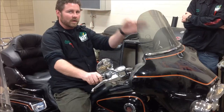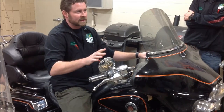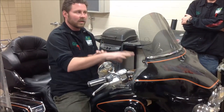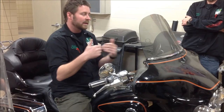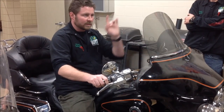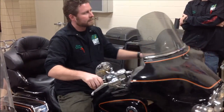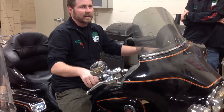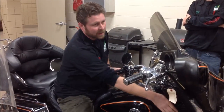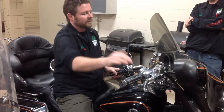So let's do a little checklist review. Before you pull the bike up on the lift, check the throttle free play — see if it's at spec to get a rough idea, and to see what it was like before you took it apart. If these cables are routed wrong and I put this whole bike back together, they're still routed wrong. You have an opportunity to catch it at a better time. And the other step to do before pulling it on the lift? Lock to lock. Get that term in your vocabulary. Every bike has a part on the triple trees and frame that allows full movement to one position and fully to another, so you definitely want to check it out.